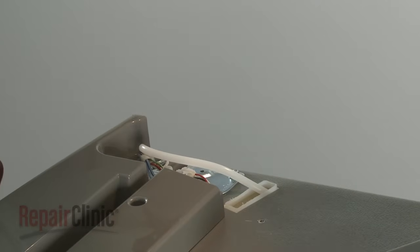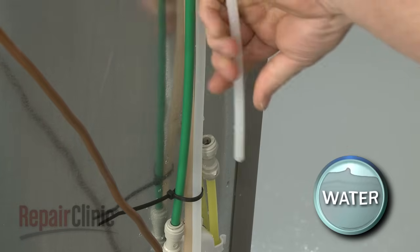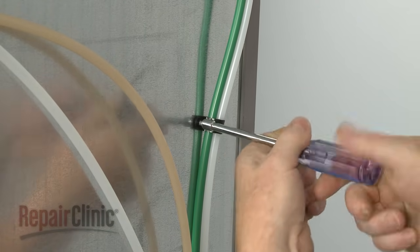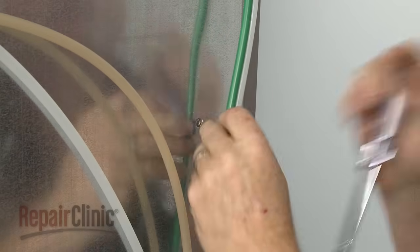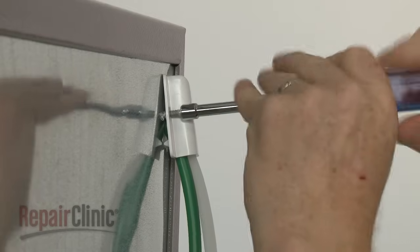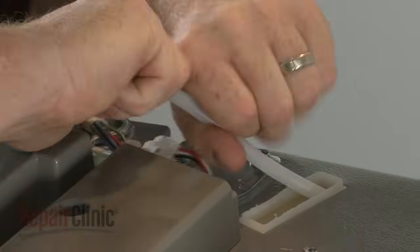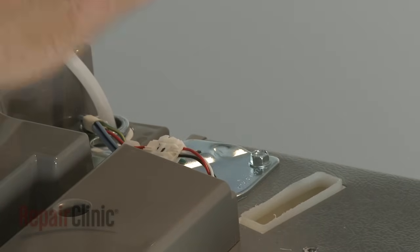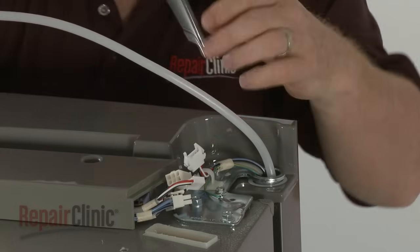To fully remove the left side door, use a small wrench to depress the locking ring to release the white water dispenser tube from the coupler. Unthread the screw to release the tube retainer. Detach the tube cover as well, then pull the water supply tube out of the channel.